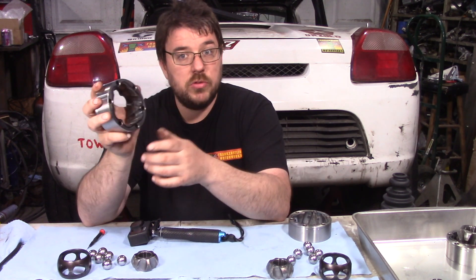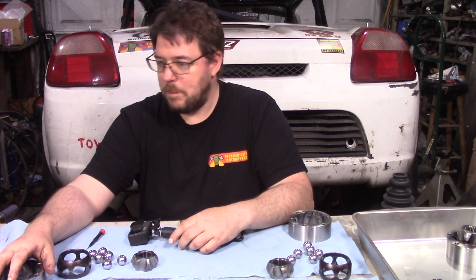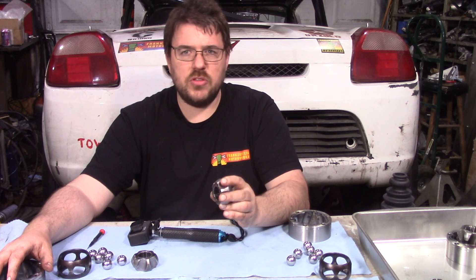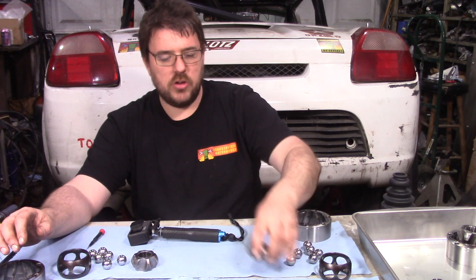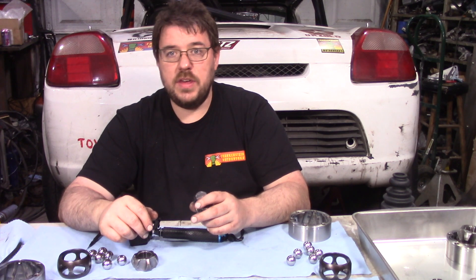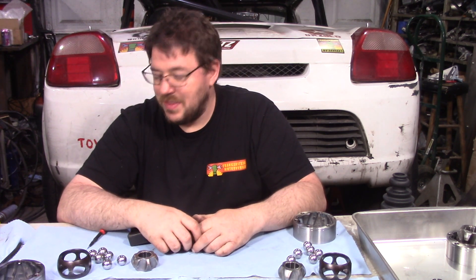I'll probably use a little bit more expensive joints on there. I'm not sure how much these would put up to drag racing, but that's the beauty of these things — it's available. Going forward, I'm going to order at least one more joint, inspect all of these really carefully, maybe order two, and I think I'm going to spend some time polishing all of these joints to get them a little bit more closer to race prepped. The Redline CV2 grease, I think, was definitely the ticket — it's still grease, and I think we're done with this problem.